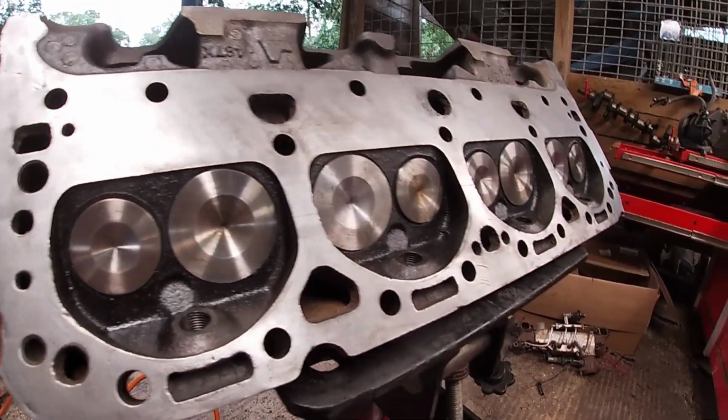So I don't know. What we're gonna do, which I would not advise for you to do if you care about anything that you're assembling, is put some of that non-hardening sealant on the head gasket. We're gonna torque them down. And I've got a compression tester. We're gonna put shop air to it, like 150 PSI of air to it, and see if it leaks cylinder to cylinder. And if it does, then we cry, because then we're gonna have to pull this head back off.